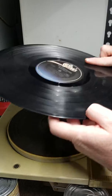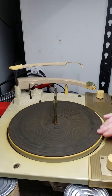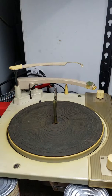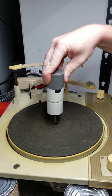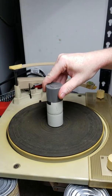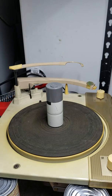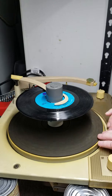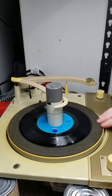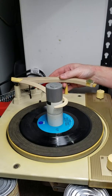Let's put a 45 on here and see what that does. With the overarm in the up position, it doesn't want to keep cycling like it did before. Let's put a 45 RPM adapter on here. We'll slide a record on here and see if it drops. Record drops - and it goes over to the 10-inch position. So the 7-inch wand is not working properly.